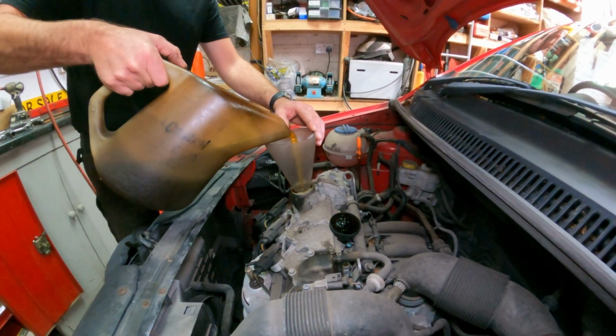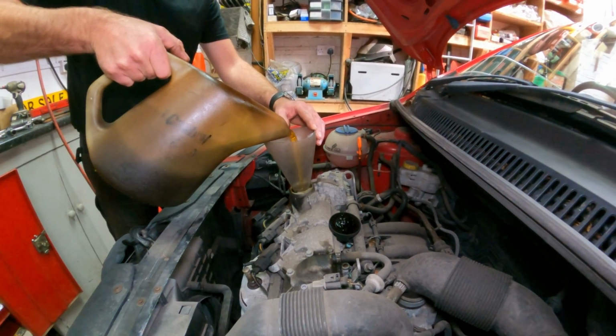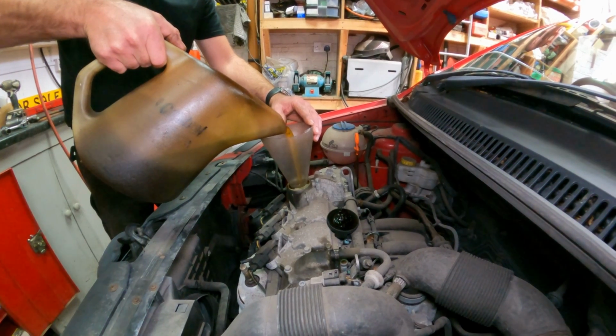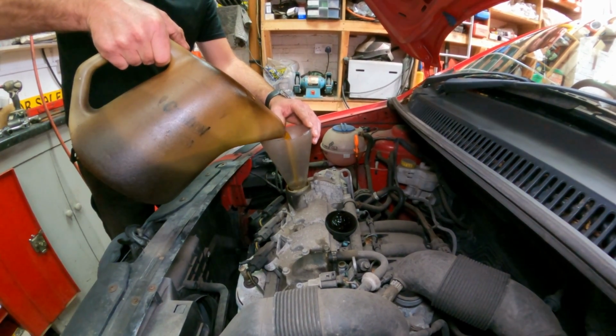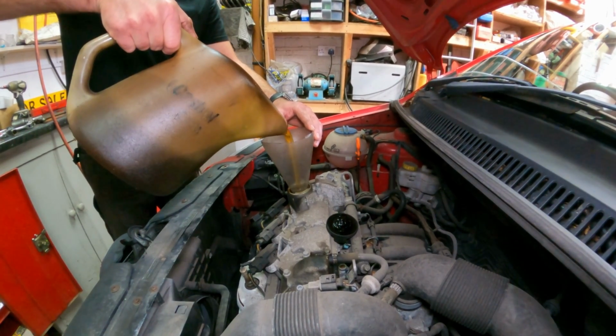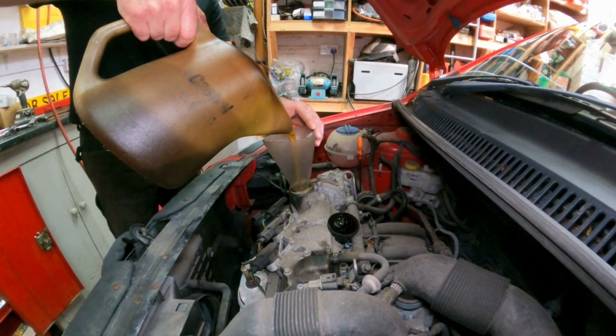So the factors where I got the parts from recommend 3 litres of engine oil for this engine. I'm going to put in approximately 2.8 litres, then just start it up, let it tick over for a little while, circulate around the engine, and then we'll leave it for 3 or 4 minutes to stand and settle and check it on the dipstick.